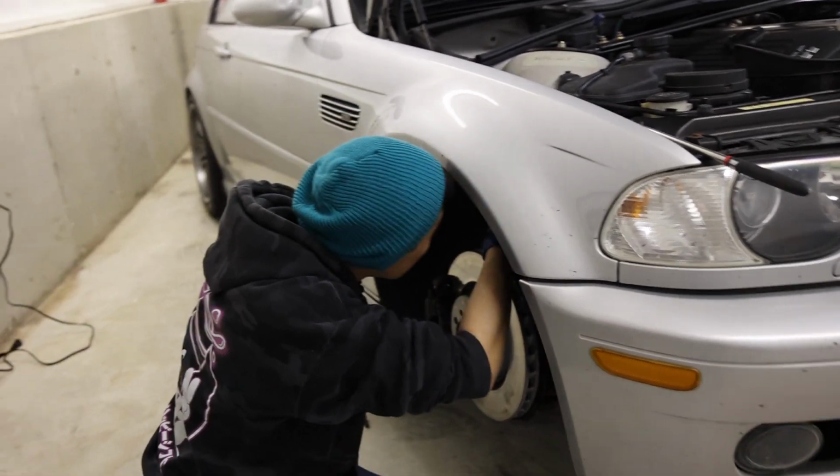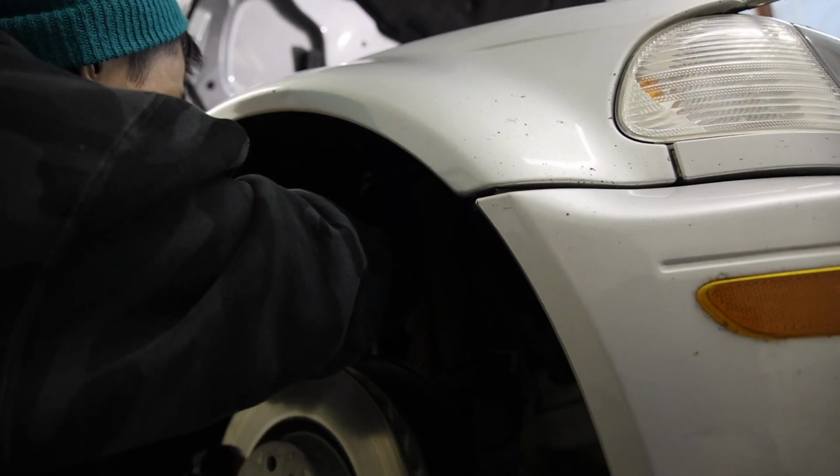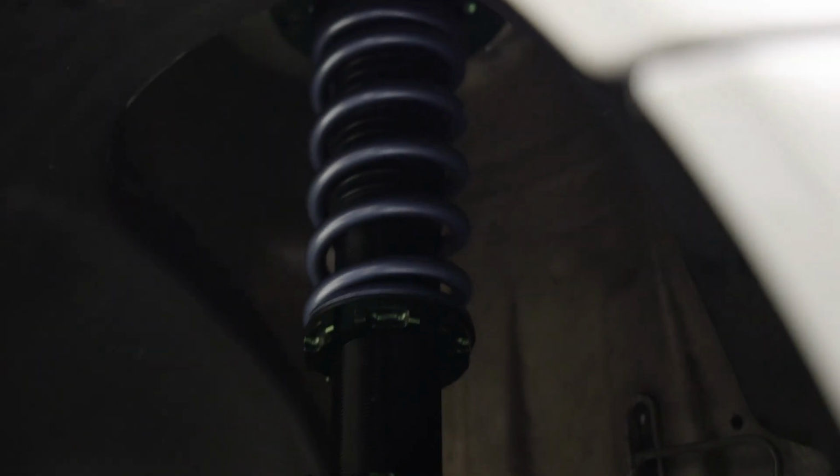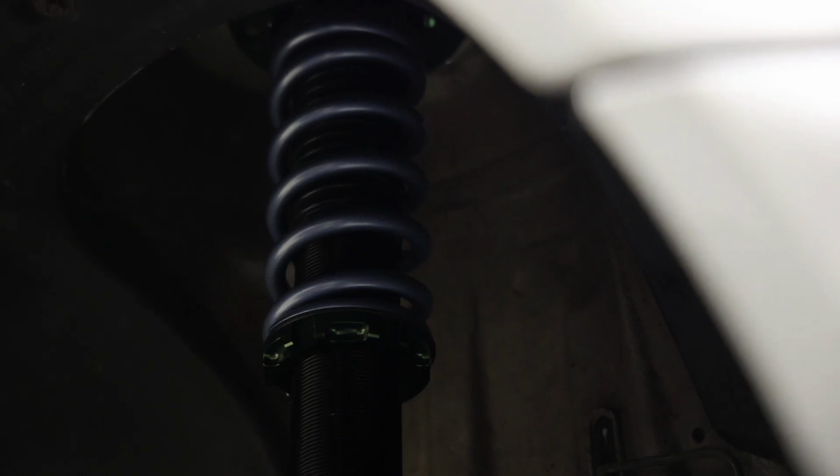Pound, my coilover technician, has showed up here. We read about preload, and we're realizing that we should have preloaded this spring better. I did preload it. I didn't just leave it flopping, but essentially you're supposed to have a 1/4 inch of preload, so you're supposed to measure the spring. So essentially you measure the spring without any load on it, and then you want to reduce the length of the spring 1/4 inch in this case. So Pound is just measuring and then screwing that collar up.